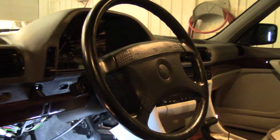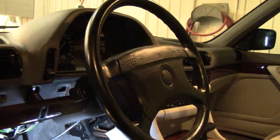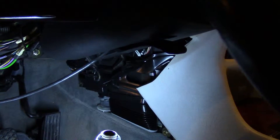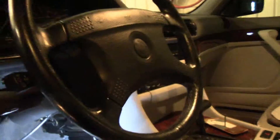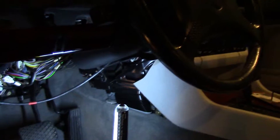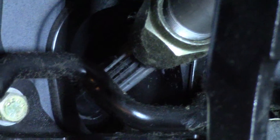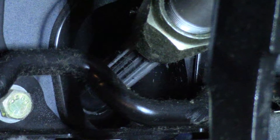I'm attempting to get my telescoping steering wheel unstuck on the 92 E32 7 series. I have this lever over here and normally from the factory we're supposed to raise that lever and then pull or push on the steering wheel, but as you can see it's totally stuck. Apparently from what I've read, the issue is with this fine spline over here — it's packed with hardened grease, and PB blaster or some sort of chemical can dissolve the grease and then you can re-grease it.